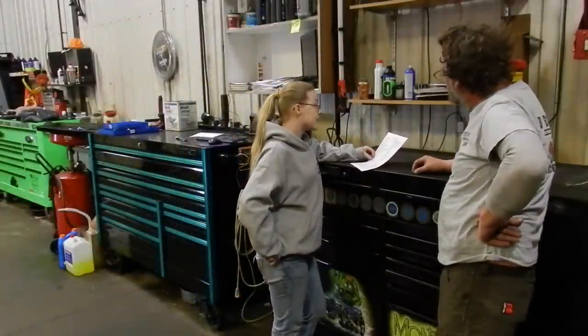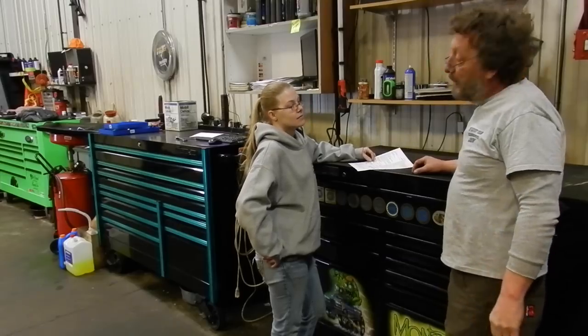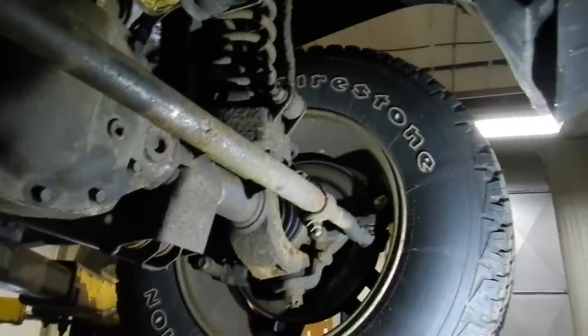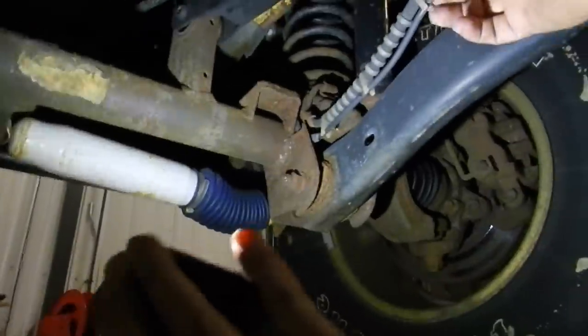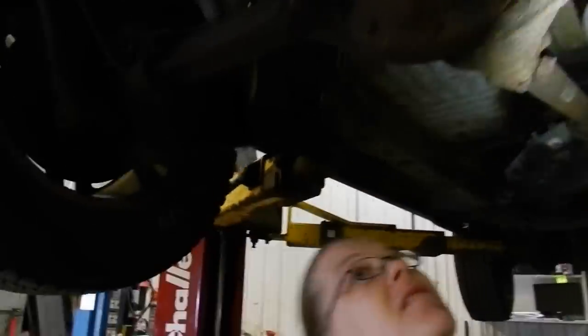Brakes and lines — brakes must have front and rear brakes, lines must be secured to the axle and/or frame. We'll lift it up on the hoist and take a look. Calipers are on, brakes are there, no brake lines hanging down. Brake lines are secure and in place on both sides, and attached to the axle as they should be. Looks like we're good.